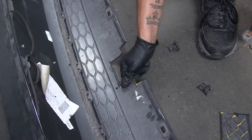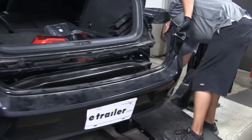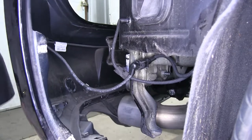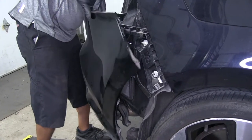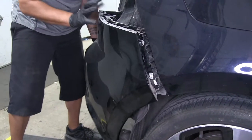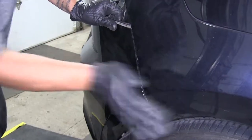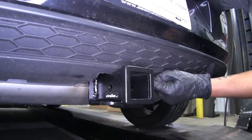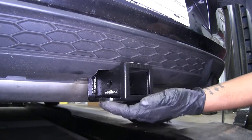Come back, clean up the excess plastic, and make sure that the opening is going to be big enough. With an extra set of hands, lift the fascia into place — but before getting too far, make sure to plug that electrical connector back in, push it in and turn it to lock. Guide the fascia in place, making sure it clears the hitch, and line all those tabs back up underneath the taillight. Work from the center moving outward. You may need to take it back off and do some minor trimming, but following the dimensions in the instructions, it should fit nicely around the hitch.